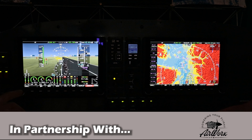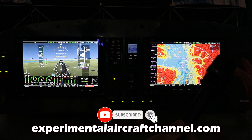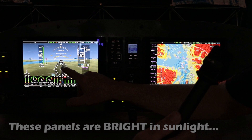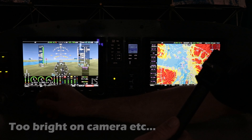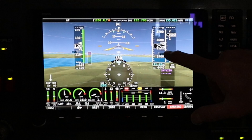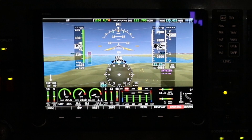What we have here is a completely integrated glass panel — all the avionics you need to aviate, communicate, and navigate. This is the primary display right here with your primary flight display. It has all your six pack of information: attitude, airspeed, altimeter, vertical speed, compass, bank and turn. I'm going to do a turn here so you can see the attitude is changing. Everything that you're used to traditionally is right here to fly the airplane.